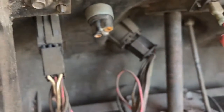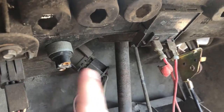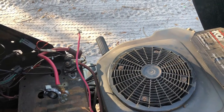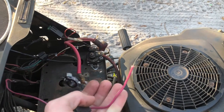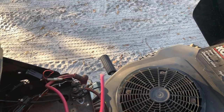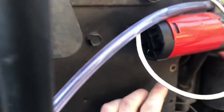I can rotate the horn around. Basically, one wire goes to the positive side which will have the fuse — this fuse I cut off a wiring harness from a junk lawnmower. That's going to get an eyelet connector crimped onto it and then bolt right to the button here. The other side goes straight down to the positive side of the horn.